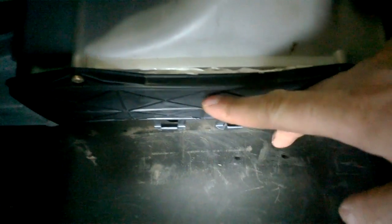This is the bottom where you insert the cabin air filter — it has four screws. The bottom plastic has a seal at the bottom. Once you remove it, you can notice the plastic is bending with age, so I'm not sure it's sealing really well. You may want to replace that seal at the bottom, or get a new cover that's not bent, to make sure water is really sealed. Air from outside may have humidity and can accumulate and drip inside the footwell.